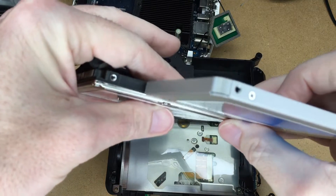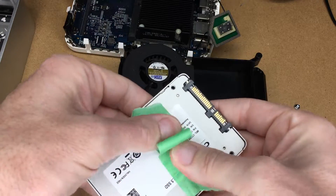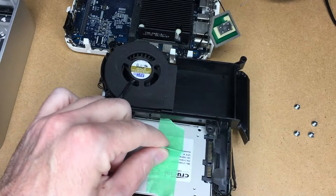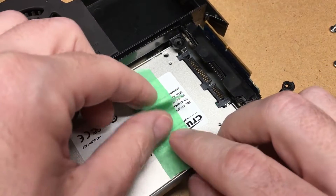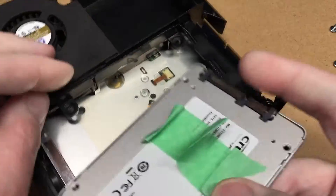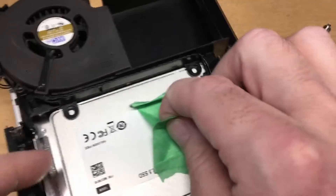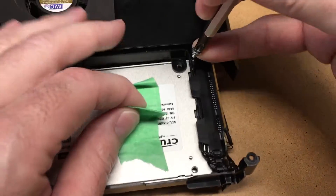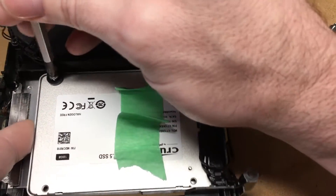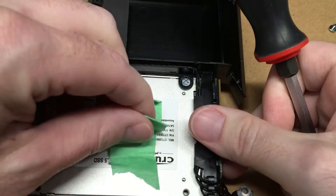We have a problem: the SSD is quite a bit thinner than the regular drive. So what I'm going to do is make a little handle out of masking tape — press that in real firm — and then I can set it in here and line it up with the connector while I slide it in. I'll pivot it in to get it in, then lift it up and slide it in, sticking my finger to guide it. Now we have it slid in. I'll put the screws in, not tightening until all are in, then do one last tightening — they don't have to be super tight since these SSDs are super lightweight. I'll use the tape to help guide the last screw in, then take it off and throw it away.